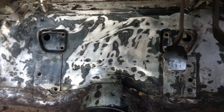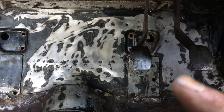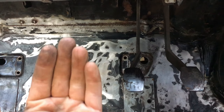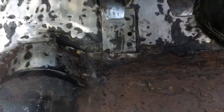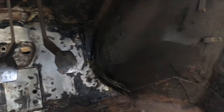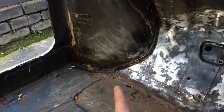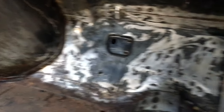You can see the bulkhead now is all bare metal. All the bits where bare metal is now — that's all pitted and horrible. Obviously you can see that's all black paint. And then we have the repair at the top — the hole's there, but I'm going to take that out to about there and then weld it from the engine bay side over. Really chuffed at that. Going to get some zinc primer on it. Obviously we're not really worrying about the floor pans because they're getting cut out. The flitch panel's in really good shape — there's that repair there which I might address. It's really, really solid and done quite well, to be fair. It's just not been ground back, so I might just grind it back and finish it. I've never seen a car this age with a mint flitch panel — it's absolutely solid.